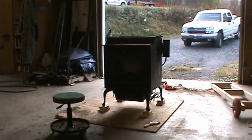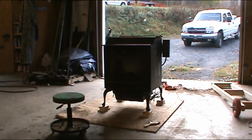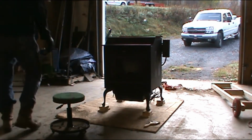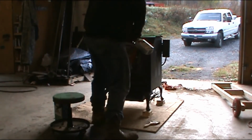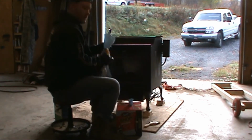Now, those of you who are auto body guys, you can use some fancy formula, pre-made stuff. This stuff's by Eastwood. I've had it forever. Or naphtha. I don't necessarily recommend brake clean, but one thing I have used with a bunch of success, believe it or not, is spray glass cleaner, like the aerosol spray. But we're gonna get some rags before we even start sanding and masking this puppy. We're gonna start wiping.